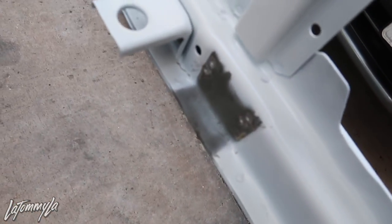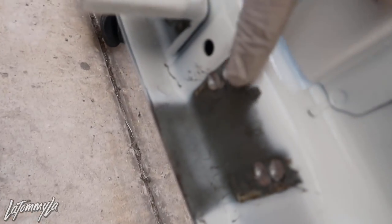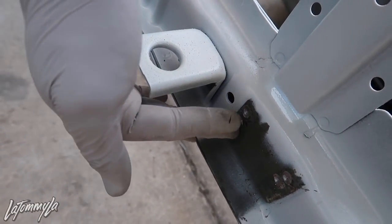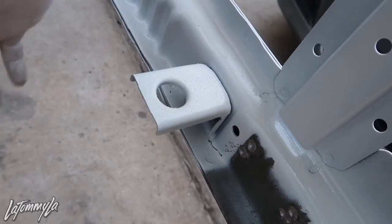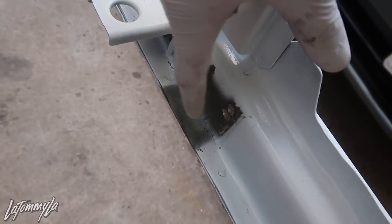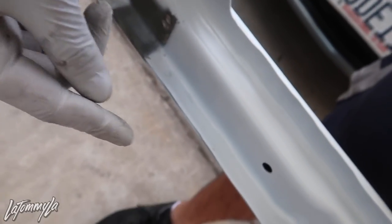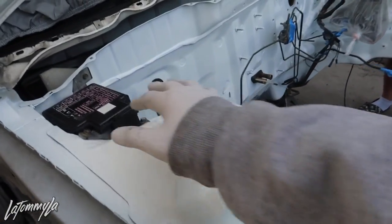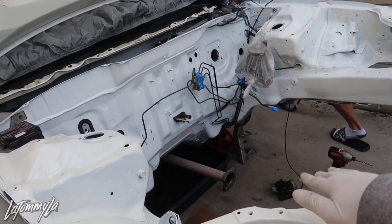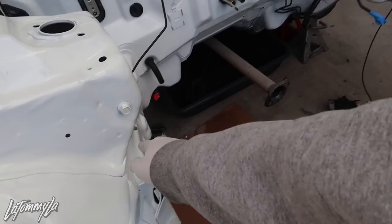I already started drilling out the radiator brackets and I also have to drill out the AC brackets. The process is really easy — you drill out the spot welds and the bracket comes right off. If you miss some spots you can take a flat hammer and hit it and it'll come right off. We're gonna get some touch-up paint since I should have done it before we painted the bay, but it's fine since it's the bottom portion. We'll use Rustoleum 2K clear to match. My brother is leaving the fuse box in the bay, we're keeping the battery there too, and we're going to tuck the headlight harness so it looks a lot cleaner.